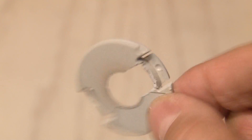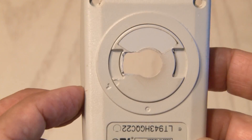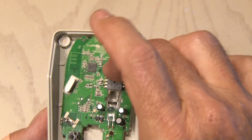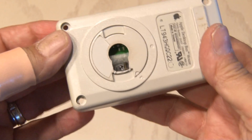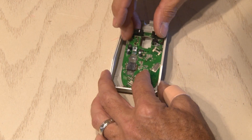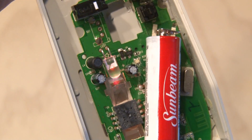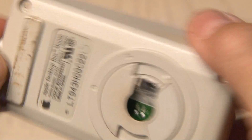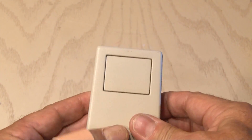Here's what the finished plastic dial looks like, and here's what it looks like back in the housing. It's time to put everything back together — the motherboard has to go in place. Make sure that the laser is shining through our hole. I'll use some hot glue and secure that board, making sure it's lined up, holding it in place till the hot glue dried. Our AA battery is in place, our mouse is fired up, and the last step is to close up the housing with the top piece — our vintage Bluetooth mouse has been hacked.